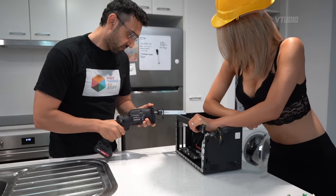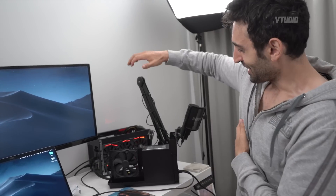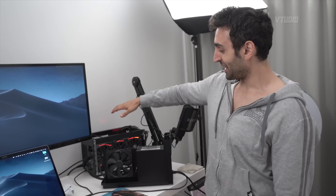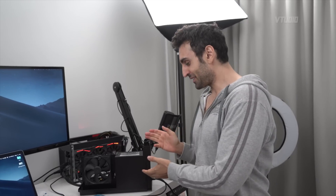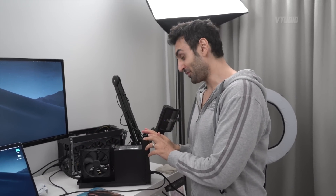The ultimate eGPU enclosure - though you're voiding the warranty if you modify that box. If you're willing to get an RX 580 or RX 590 instead of the Vega 64, then get yourself an OWC Mercury Helios 650, because that guy is quiet. You can even unplug the fan for extra quietness. Of course, make sure your system is stable and you're in a quiet environment. But if you're getting a big fat juicy GPU, you're gonna need a slightly bigger box, in which case the Razer Core X is easy and nice to use.